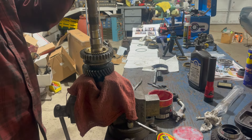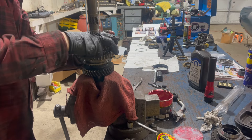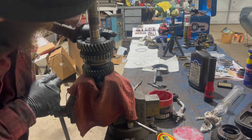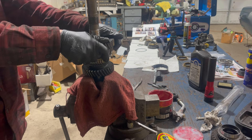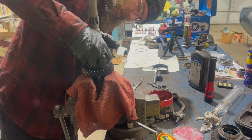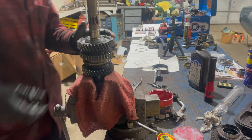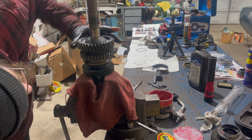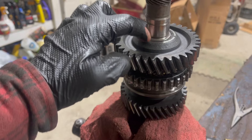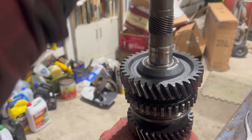And then first gear right at the back - I did grease all of those surfaces. Lines up straight there, so that seems promising, and it engages and grabs. You have to be careful not to send that too far or it gets jammed up. If second and first stacked up correctly with the synchro, this should be give or take flush right here. I'm going to grease these surfaces and press on the bearing.